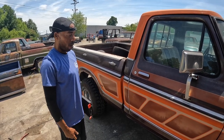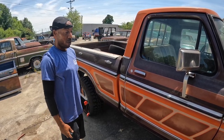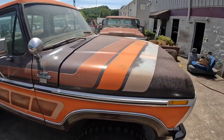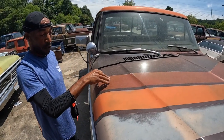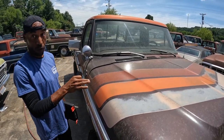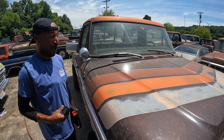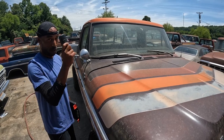On these older ones, a lot of customers like to preserve as much of the integrity of it as possible. So you just don't want to go at it blind. Always, in any case, you want to see what you're playing with so you don't hurt somebody's. Kind of like on the hood where it's really fading here because someone probably just rubbed it too much. Yeah. Especially, and I see this a lot on some vehicles, these painted on decals. A lot of people want to preserve those more than anything because they stick out. So me personally, using a machine on something I don't know anything about is just a cause for taking money out of my pocket or ruining something that's original. And you definitely don't want to do that. So always meter the paint first.